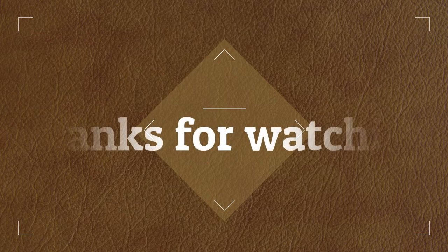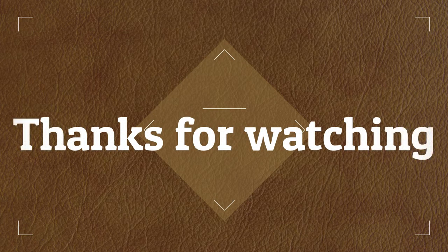Okay guys, I don't know what happened, but I had lost sound for my ending, but just really quick before we end the video, I worked on it a little bit off camera, and I'm still having the same problems. I showed you earlier in the video that we have good spark, so I don't think it's spark. It might be the carburetor or something like that.